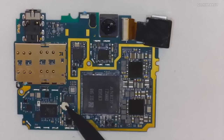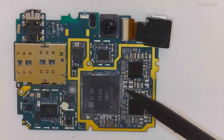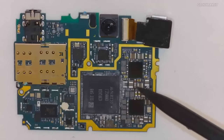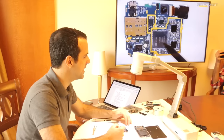An interesting thing that you would have come across, of course, in this industry fairly often is how processor and memory are put together. When you're operating at the level of performance that you need out of a processor like Snapdragon 820, the coupling between the memory and the processor is really, really important, right? You're operating at such a high level of performance that anything you do to bring the memory closer to the processor actually matters. The travel distance between the processor and the memory, where data is being fetched back and forth, is very, very critical. So the way the industry does it is you actually stack the SoC, the chipset itself, with the memory.